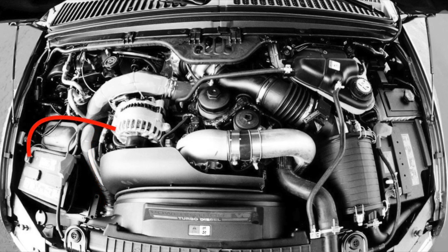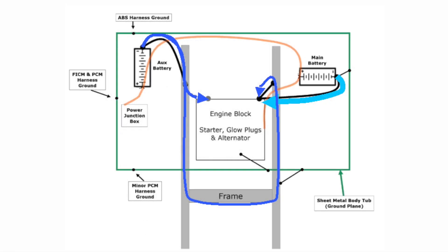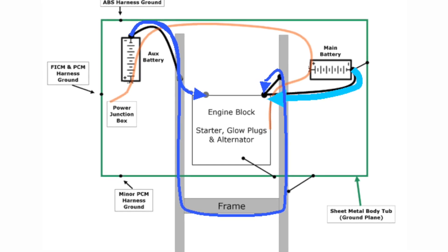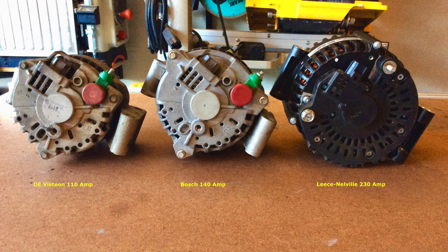This could have been done with a shorter length and smaller gauge to the firewall connection for less money. It's possible there is a factor in the fender-side connection which may hinder conductivity. More of a pathway from the fender to the block during starting is not the direction I want to go. If I installed this alternator cable directly to only one battery, it would upset the battery balance I was trying to achieve in my earlier work.